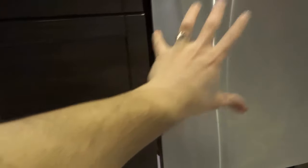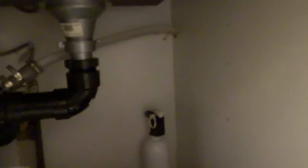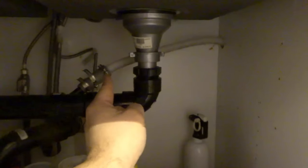If that doesn't work, then it could be a problem with the actual drain hose. Inside your dishwasher there's a pump and filter that sends the water through the drain hose. What you're going to do is look underneath the sink that is near the dishwasher. We have the dishwasher here, and then there's a hose. I actually did this myself so I know exactly what this looks like. Underneath the sink right over here, the dishwasher is right there, and that's the drain hose — the one that's connected to the drain, separate from the actual supply line.